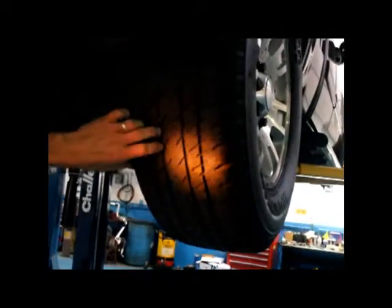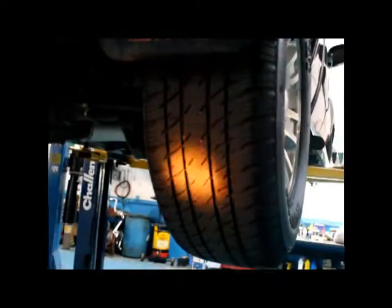We usually actually go a little one step more than what state inspection would require. If they're rounded off, cupped, that would still pass the state inspection, but we usually try to get rid of those tires just for the fact that they'd be quiet for the customer when they buy the car. They can feel that they have a safe car.